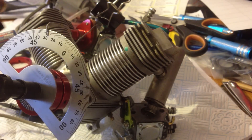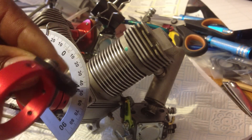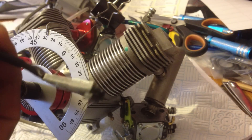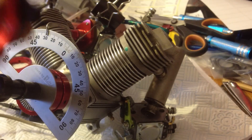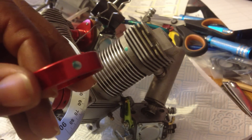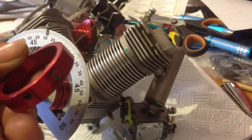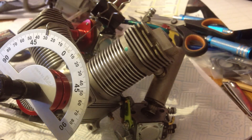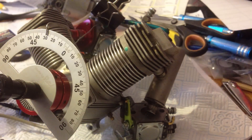So this is the sensor ring tool — that's your plug on the end of the tool sensor. You have the magnet ring: green is for south, red is for north. This engine is running on a two-magnet setup, one for each cylinder. The ignition does the rest.